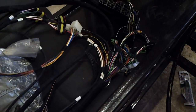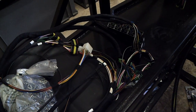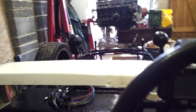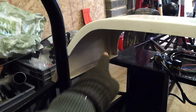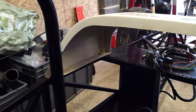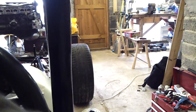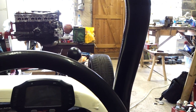The kit is designed for a 7-style car, which is fantastic, but I'll need to tweak things and possibly extend some wires. Another nice thing about the loom is it's all IVA compliant — it has front repeaters going onto the wings rather than indicators. For the IVA test that will pass with flying colours. When you have them mounted onto the sides here, you have issues with the 5-degree rear view. From the back of the car you're meant to have 5 degrees of visibility, and the wheel arch gets in the way. Also, because the scuttle panel is mounted at an angle, you just don't see it. So the solution is to mount them on the outside of the front cycle wing — not the prettiest solution, but it works and is IVA OK.